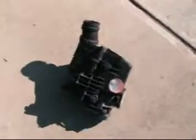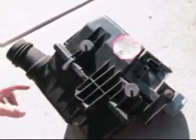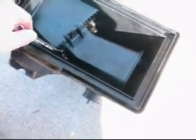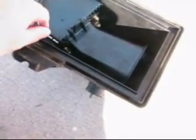Okay, here's the air box that's been pulled out, and basically what we have to do is remove this off the air box, and we'll go from there. If you need to open up your air filter, there's 4 of these clamps all the way around, and you just loosen those and the 2 parts separate. Okay, I've gone ahead and taken apart the box, unclipped it, and you do need to take it apart to get to these bolts and pull them off. So there's 4 bolts here. I believe it's actually 9mm to remove those bolts, so I'm going to do that first.